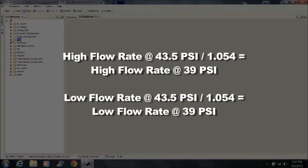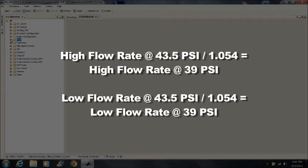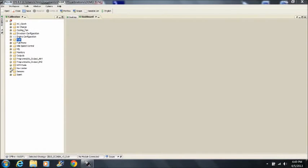If the low flow rate is not available, figuring it out is pretty easy to do with our software. Injectors tend to vary a bit at lower flow rates anyway, so if you don't have the low slope value, just multiply the advertised flow rate by 1.15. This will give you a starting point. We'll fine-tune it later with our software. Next, you need to set the rev limiter.